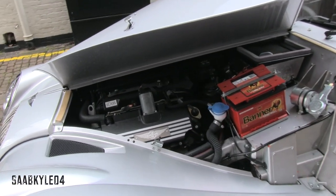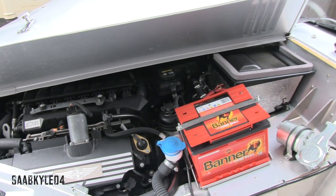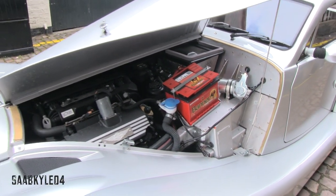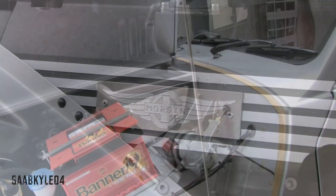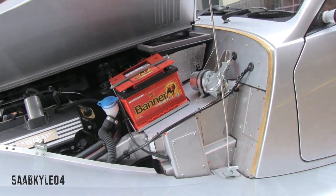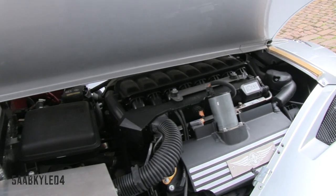The all-aluminum 4-cam 32-valve engine is naturally aspirated and features BMW's double Vanos variable valve timing system, a compression ratio of 10.5 to 1 and a red line of 6,500 RPM. In Morgan's application, the engine produces 367 brake horsepower at 6,300 RPM and 370 pound-feet of torque at 3,600 RPM. That's an improvement of 13 and 11% respectively over the 4.4-liter and a little higher than BMW's applications.